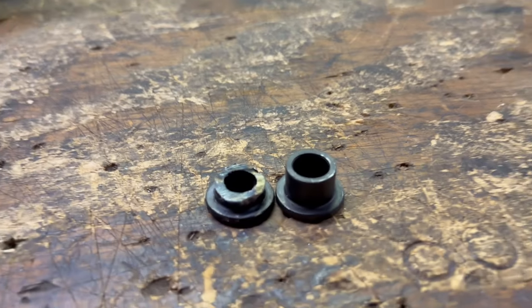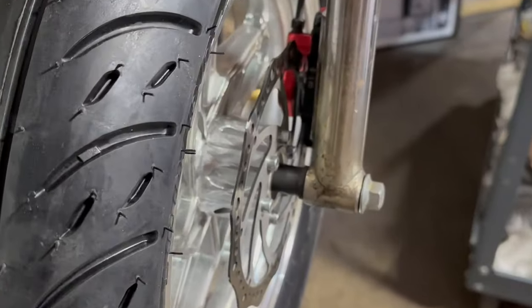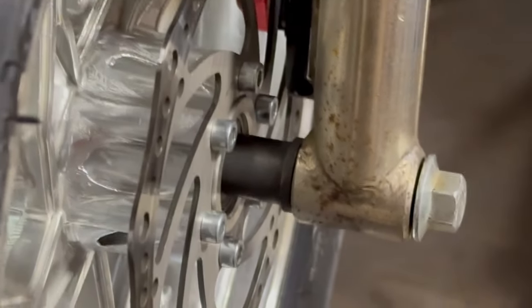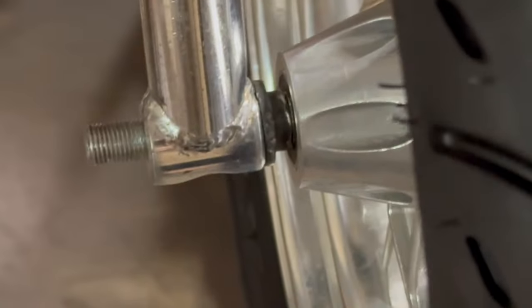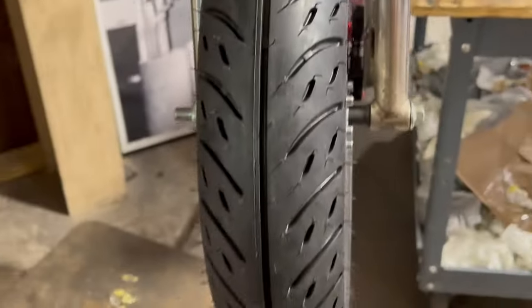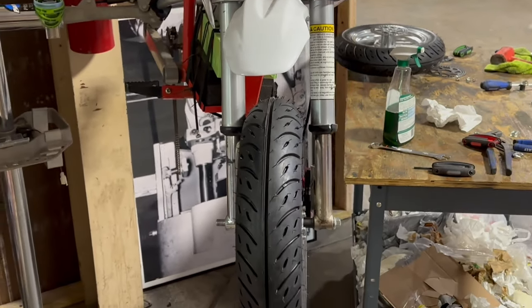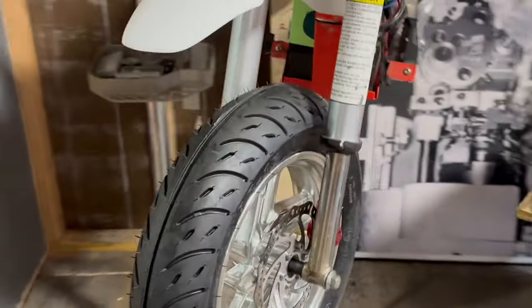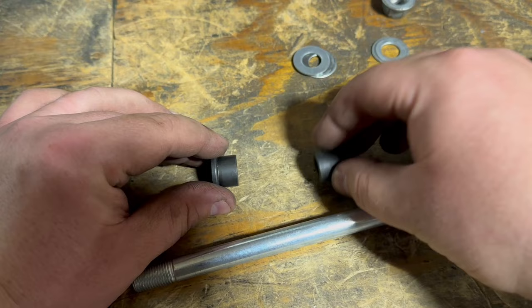Now I'm going to show it to you on the bike. On the caliper side, I just used the stock MX500 spacer and I'm using the MX500 axle as well. On the other side, I have that modified spacer — I used the RSF spacer and cut it down quite a bit. You can niggle and get it to where you need to be. The thing that bothered me is that my wheel sits really far to the opposite of the caliper side, but I really couldn't figure out any other way to clearance it and it still rides good.